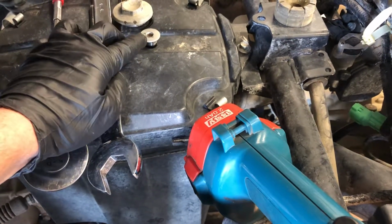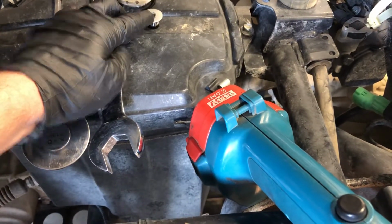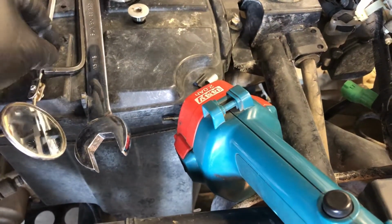We've got an Allen wrench here that will be the inspection window that we find top dead center with. I also have a mirror, and I use that to find top dead center, so we're not having to pull the fuel tank to look down in that sight window. And then I've got a light here so I can see a little bit better.